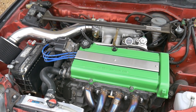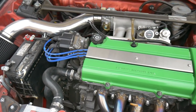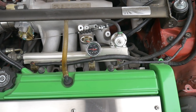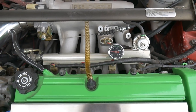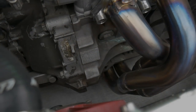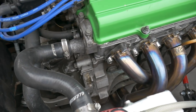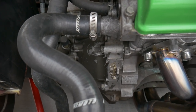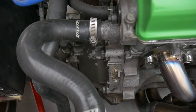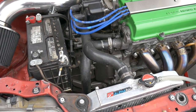The car is still OBD0. I'm using all 90-91 Integra electronics such as the distributor, OBD0 injectors I believe off the CRX SI, and I have the PR4 ECU. I'm still using the same engine — the high compression B20B I purchased from JDM Alliance — with a 92-93 LS cable transmission, Competition Clutch Stage 1.5, and an OEM flywheel. I really like that setup; the clutch grips very well and I haven't had any issues with it.